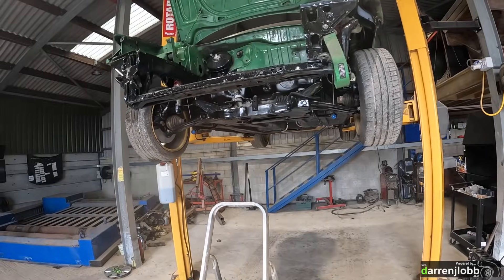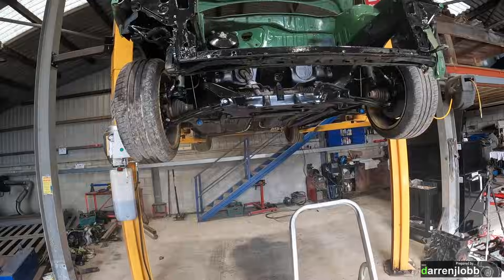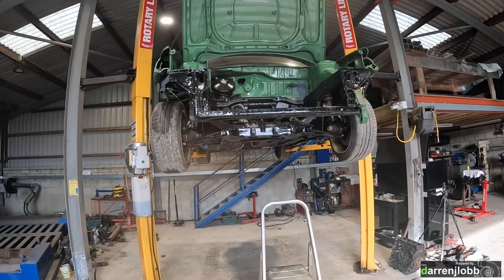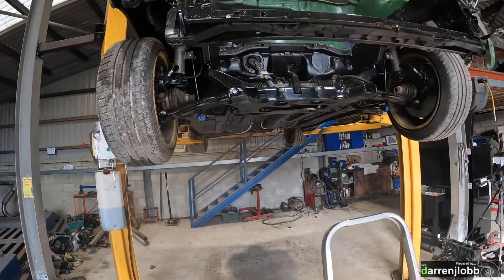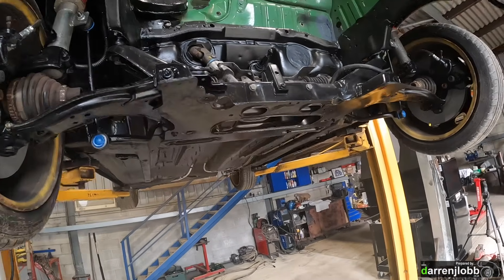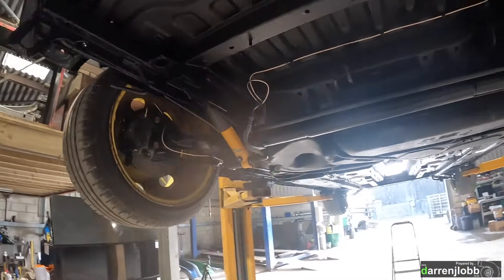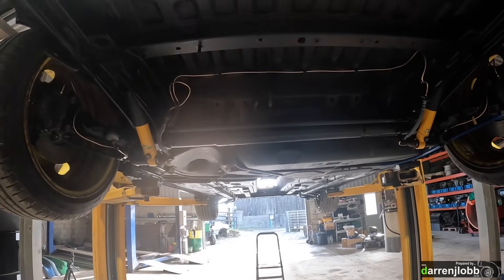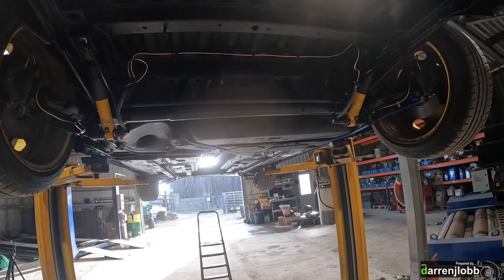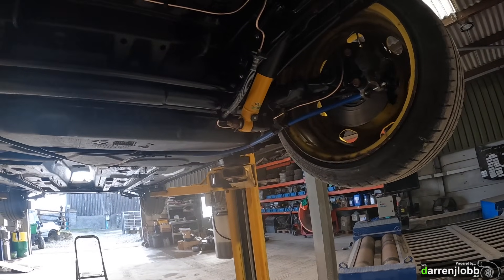It is now a roller. I'm just making this clip now because I'm about to drop it off the lift, and that is the car done chassis-wise - we're going to move on to the engine, which should hopefully be a bit more interesting. We've got all the subframe back in, suspension in, brakes all back on, new brake lines running through, the axle all mounted up again with new brake line flexes, new shocks, rebuilt calipers, and new handbrake cables.